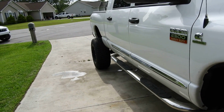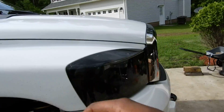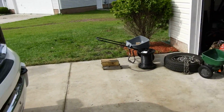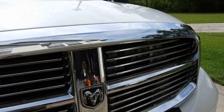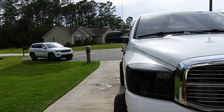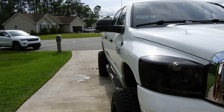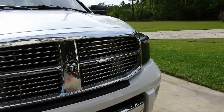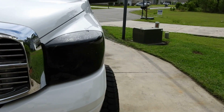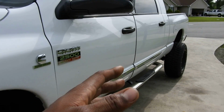I had to use a jack, and I was holding the axle to keep it from rotating on the jack, and it was a huge struggle, and I would never want to do it again. So if I had a tip when it came to doing the rear, do one side at a time. Loosen everything up, take the U-bolts off, put a jack underneath, lower it down, put the new block in, jack it up, then go to the other side. You'll be able to get it down low enough, and like I said, if you can't, just go to the other side and loosen it up.